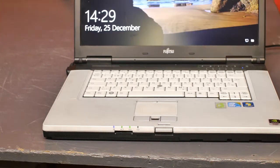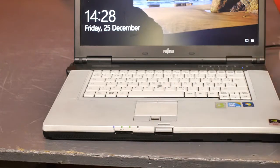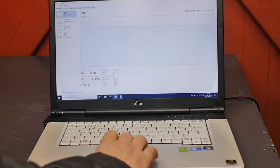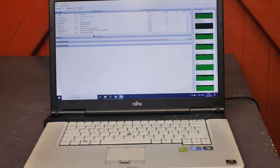It's a first-generation mobile i7 processor with four cores and hyperthreading. But unfortunately the internal fan makes a whole lot of noise when I push the processor. So I think it's probably a good idea to open up the laptop and blow out all of the dust, and hopefully the fan doesn't have to go into overdrive to keep things cool.